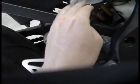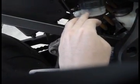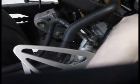And there's also checking your rear brake reservoir. Make sure when you stand the bike straight up, and it's not on its stand, the fluid level should land somewhere between upper and lower for the rear brake reservoir. Coolant reservoir has an upper and lower marking as well. So you just want to make sure those haven't changed abruptly overnight or whatever. Make sure they're in the right range.